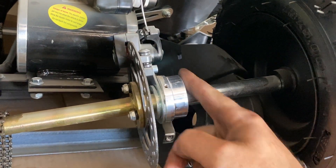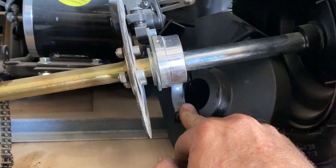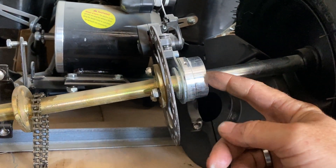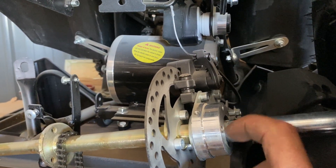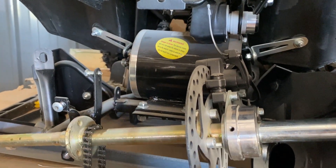It's very narrow here but very thick here. All you have to do is loosen your axle bolts — don't take them out, just loosen them. Then put a screwdriver in the little holes right there, and just tap it. When you tap it, it rotates back and will tighten up the chain.